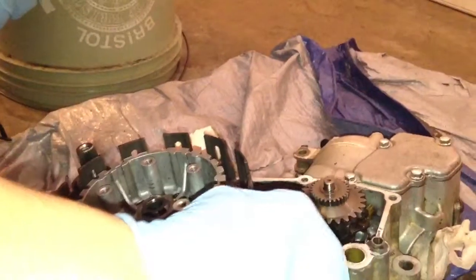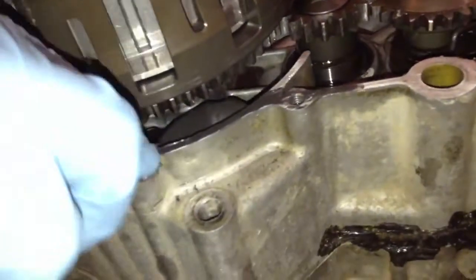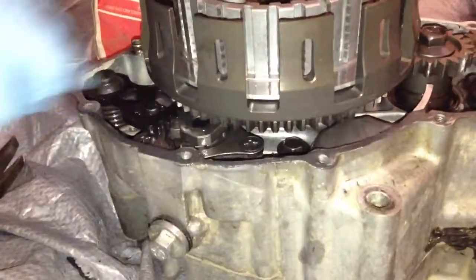So then you take some and you just put it on your finger and dab along. Just get a nice, smooth, even coat everywhere. Not too much. It's your own gasket maker. A little bit goes a really long way, as you can see. That big blob, and then thin it out all the way around. Because gaskets aren't too thick and you don't want to go crazy with it. You don't want to end up like that. Keep going.